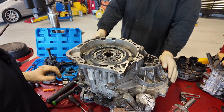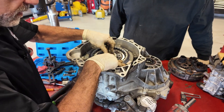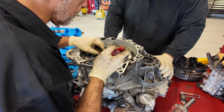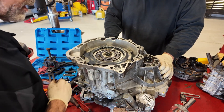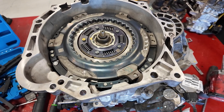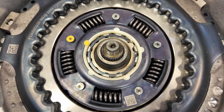With the first snap ring installed, we'll install the sprocket. Make sure it seats all the way down and then we'll install the snap ring. The snap ring is installed and we're fully assembled. There it is — the new one installed. We're getting ready to install this transmission assembly back in this Hyundai.